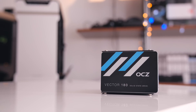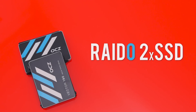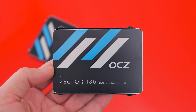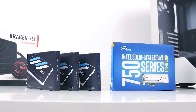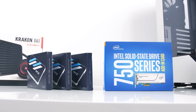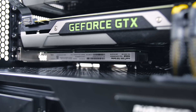In this video, we'll be seeing what type of performance we get with one drive, a RAID 0 array with two drives, and just for fun, triple SSDs in RAID 0. To clarify, we are doing RAID 0 to achieve the best read and write performance possible, as the drives will be used for video editing. Choosing any other RAID configuration means sacrificing either speed or capacity. All of the OCZ drives will be used as secondary storage, separate from my main operating system drive, which is this Intel 750 SSD.